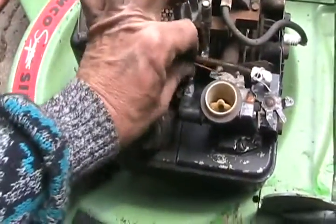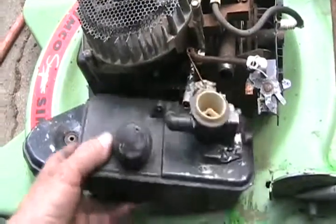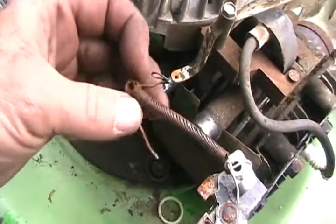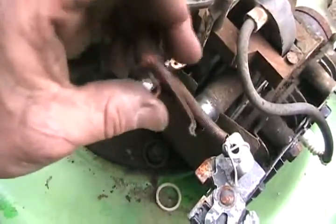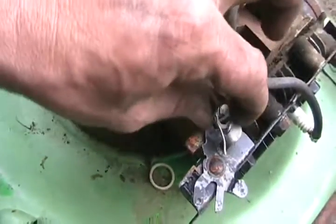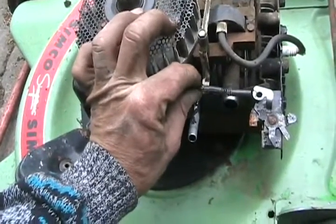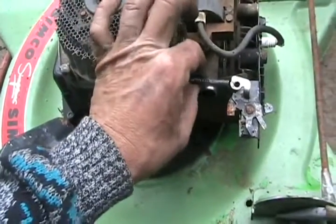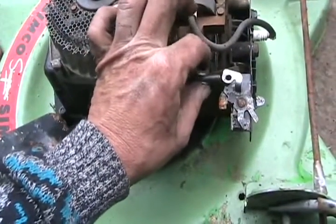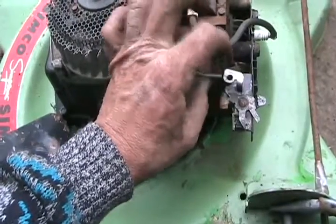Now to fix this bastardized governor mechanism and fix the carburetor. They had that little carb linkage buggered up, so I'll have to replace that — they sort of used wire to compensate. I'll get rid of that wire and put her back to stock. I found a good-condition little link, and the spring is not that great, but you can always shorten them if you're not running fast enough — just snip a little bit off the end and bend it over and make a new loop.